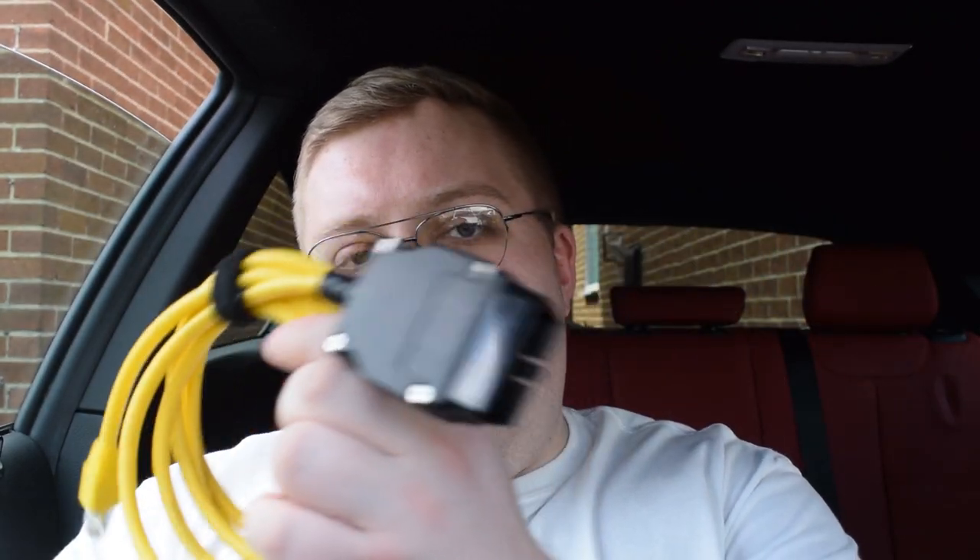The next step is to make sure you've got all the relevant hardware. I've got a laptop here and because it doesn't have an Ethernet port I've got an Anker RJ45 to USB connector alongside the OBD to Ethernet cable. If you're planning on using the OBD agent, make sure you bring your phone charger out to the car, or if you're planning to use Wi-Fi make sure your phone is fully charged. The last thing you'd want is to be halfway through mapping your car via Wi-Fi and then your phone die.